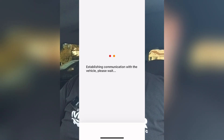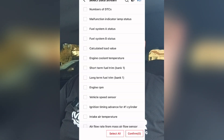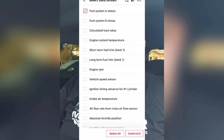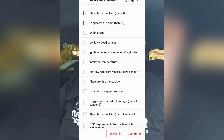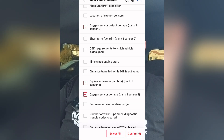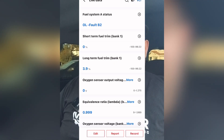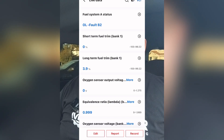Just to give you a heads up — I already created a lean condition on the vehicle by disconnecting a vacuum hose, and we're going to see this in our live data. If you're a technician who just runs with whatever data pids your scan tool gives you, you need to change that habit. We want to look at only what's pertinent to the diagnosis: fuel system status, short-term fuel trim, long-term fuel trim, after-cat O2, lambda, and Bank 1 Sensor 1 O2. That should be all.